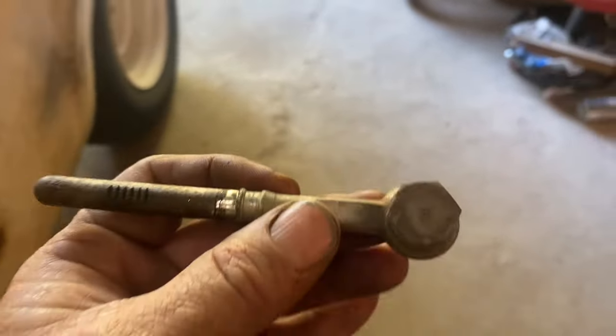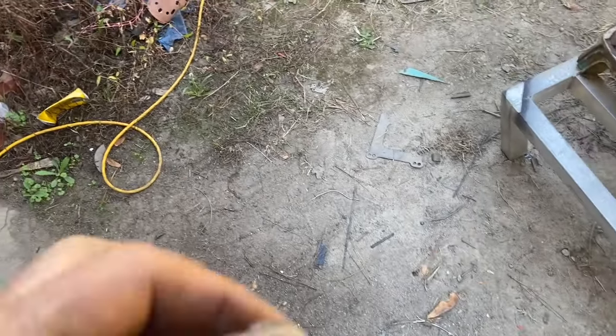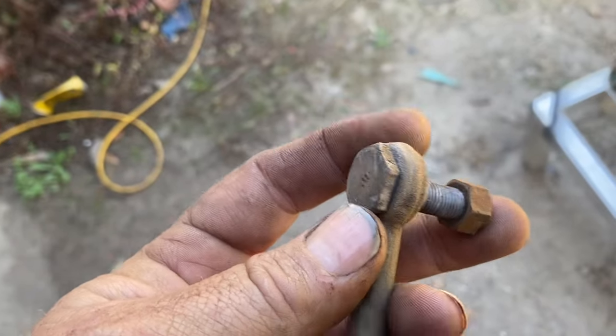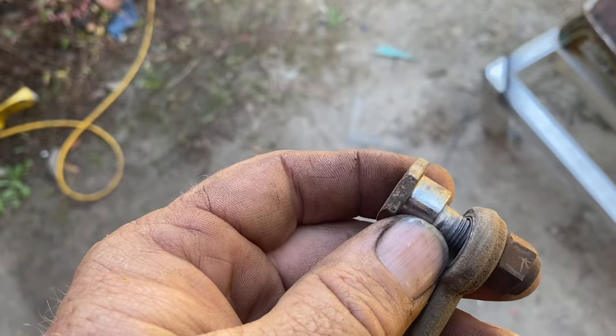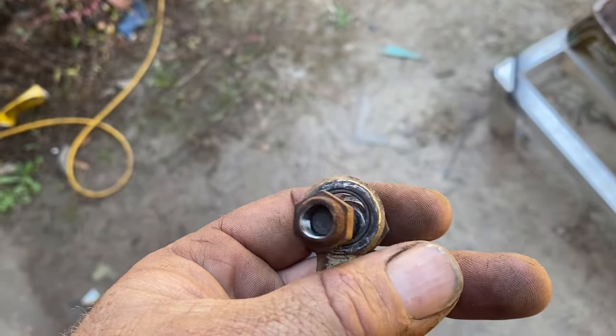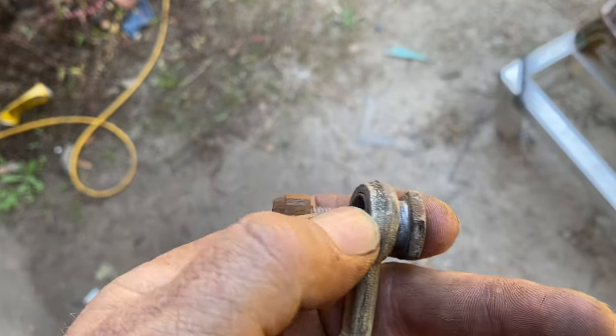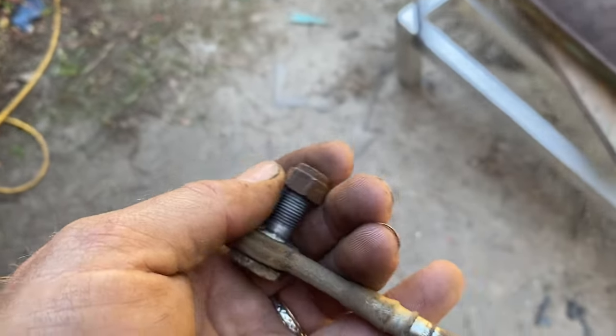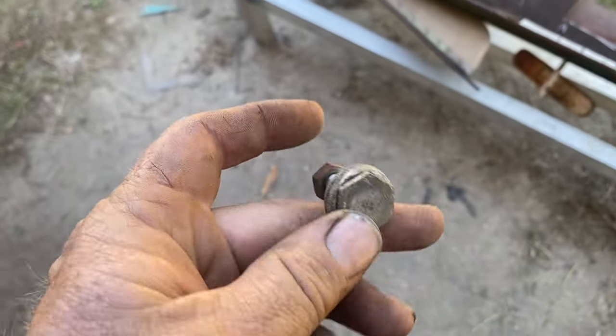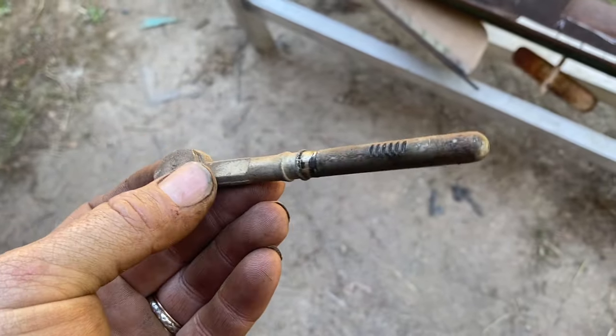Here's why I tackle that situation the way I do. A lot of people are not aware of this. More modern brake stuff has an E-clip. These rods are held in by a shouldered bolt through an eyelet. That's how they fit together. And it's easier to get this taken apart when you have a little more light coming in from where the master cylinder was. So that's why I do it the way I do it.